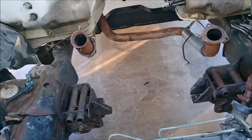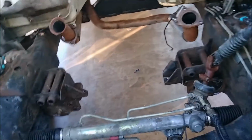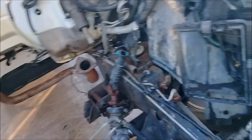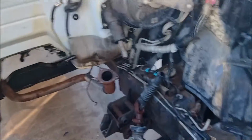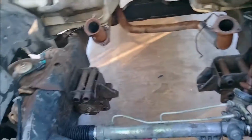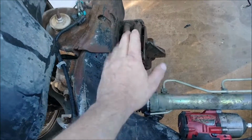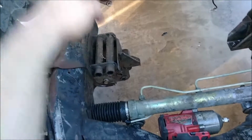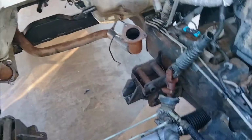I know it wasn't the 44. I did reuse them when I did my other red truck 1500 swap. It was also blocking the knock sensors, so I ended up putting the knock sensors on extensions. On that truck, after I got sick of all that and blocking stuff, I just made some dirt track mounts that come up. I have steel plates that bolt to the block like this, and they come over like this, with a simple half-inch bolt on each side. So I can set the motor in, and it also has slots in it, so I can slide it over or whatever.